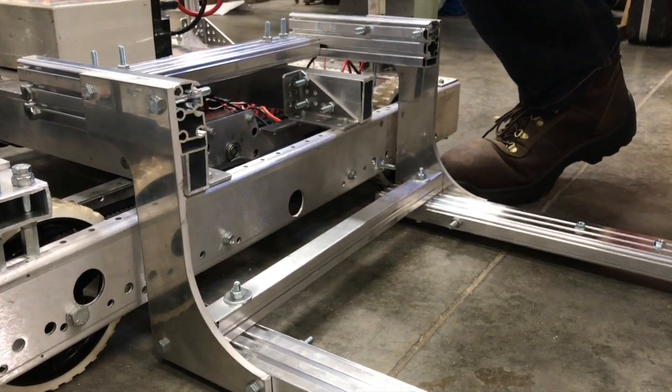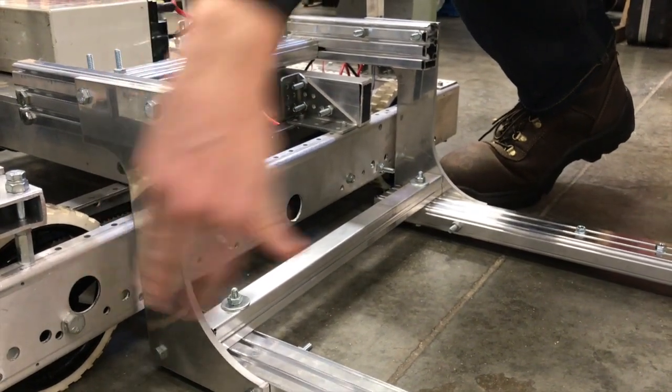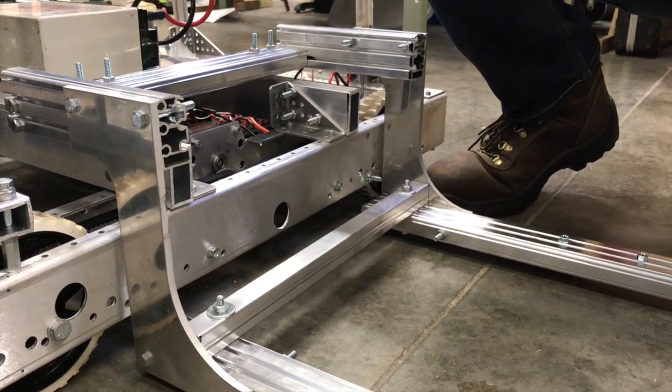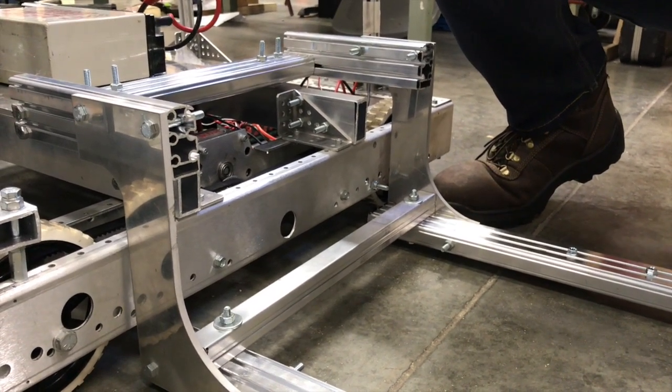In our lift videos, you may notice the arms droop a bit. That's because what stops the arms from going down is when this piece hits the side of the chassis, and there's a little too much clearance there when it's leveled — that's why they hang down a little bit. The arms really don't flex too much, at least not that we've seen so far, so it does seem much more stable than it may at first appear.